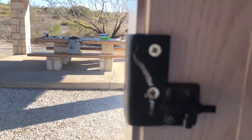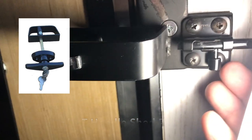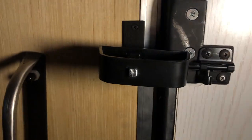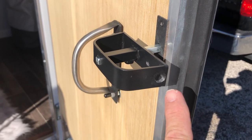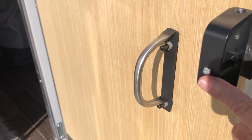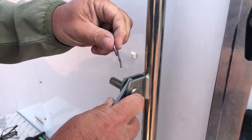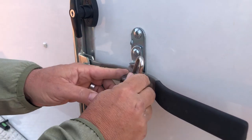Another thing I wanted to show you is our lock mechanism for inside the cargo trailer. There's the lock in the closed position — you simply go over to the lock mechanism, flip it up, go over to the hole, and it's closed so you can't open it from the outside. We have a lock on the inside to lock it, and we also have a handle so you can pull the door to, which makes it easy to lock. To put this lock back in place when you leave, it's simply a matter of putting the pin through, latching it back in, closing it, and putting the padlock on.